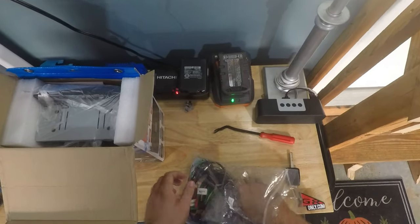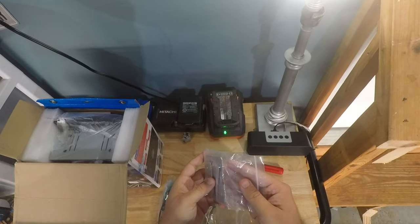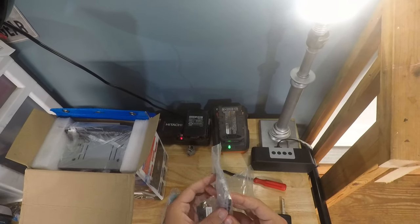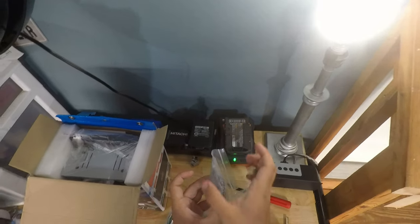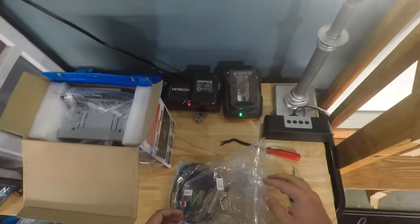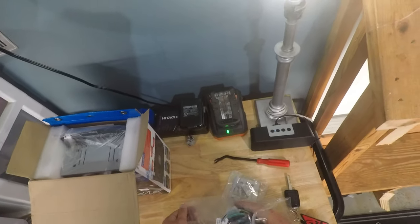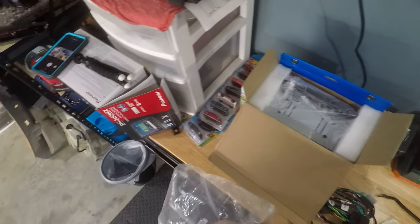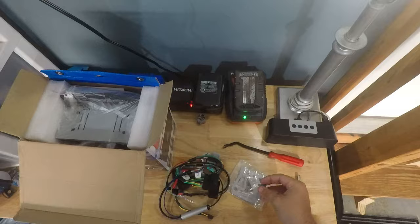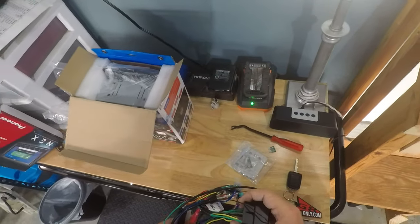If we check this bag out, this is the new radio mount. Once the fascia kit is installed, this goes on either side of the radio, and there's a tab on either side that slots into place when you push the radio in. The interesting thing about this kit is not only was it much cheaper than our alternative option, but personally, in my opinion, it looks a lot nicer. The good thing is this retains factory steering wheel controls right out of the box.